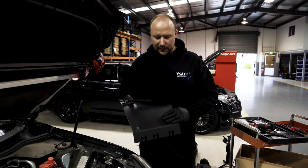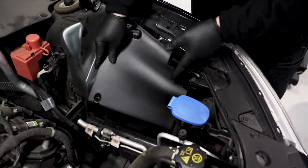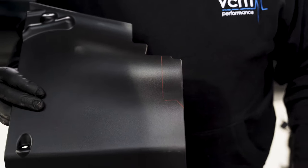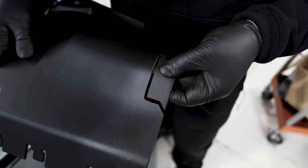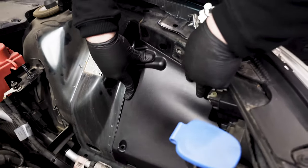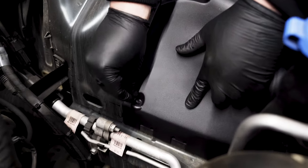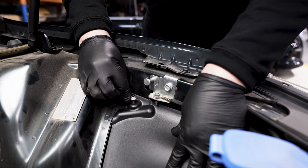The infill panel goes in where your air box used to go — it just covers up the open hole near your wheel arches. On this VF model, the infill panel will need to be trimmed to clear the headlight. To fit the infill panel, take off the earth to make it easier to fit over the stud, then refit the earth and post back on. Reuse the post that was retaining the original air box and one of the original 10 mil bolts from the air box.